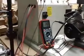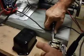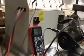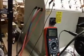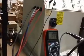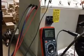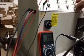Our voltage is still a little bit high — we adjusted a little bit too high. We want to take our needle nose again. Released it. We're about 14.5 now. Now we're down to 14.3. Our air gap and everything is still ready and working properly.